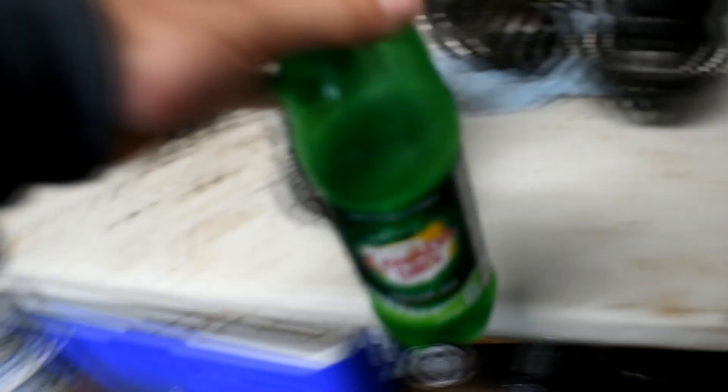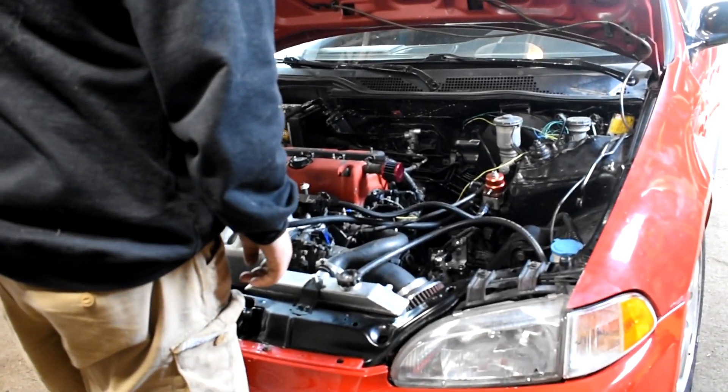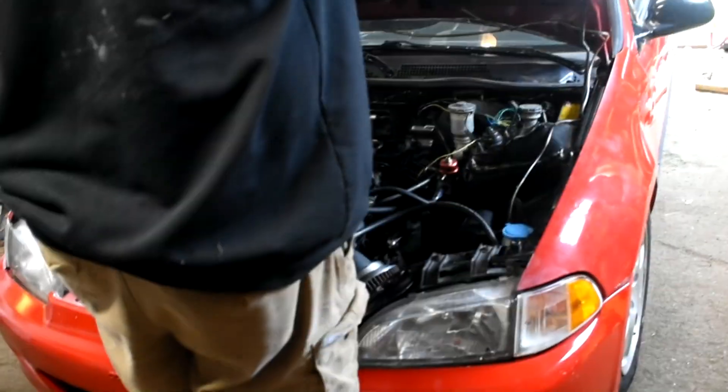Civic's back in the garage. Did the one second gear pull on her and yeah, we're gonna try to figure something out with the transmission. Nathan's here — gonna look at this. Could be the cable, shifter box — I'm gonna take them all off. Anything to do with the transmission, clutch slave cylinder — I'm looking at everything. This car has always had transmission issues so I want to make sure everything's good before I put it back together for the third or fourth time.